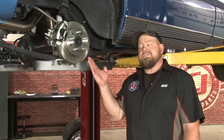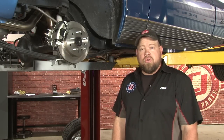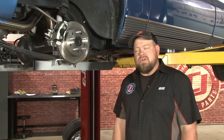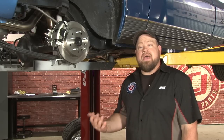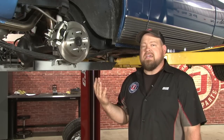And that's how you install SSBC's rear disc brake conversion kit on your early Mustang. Keep in mind, if you do have an earlier model than our 70, you may have a residual pressure valve built into your master cylinder. SSBC's instructions detail on how to remove this properly to get proper pressure to your rear brakes. In the case of our 70, it's not going to be an issue.